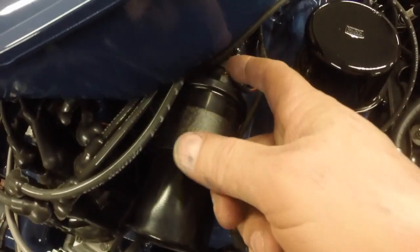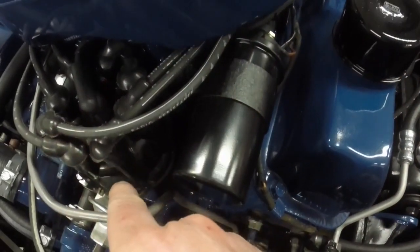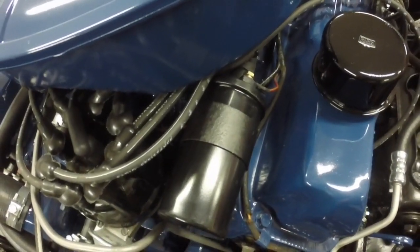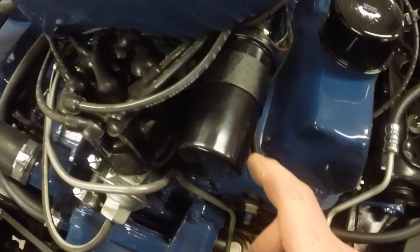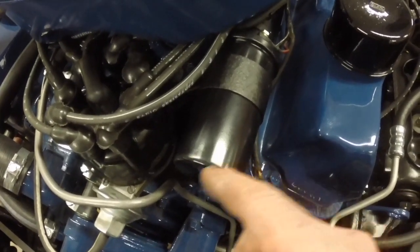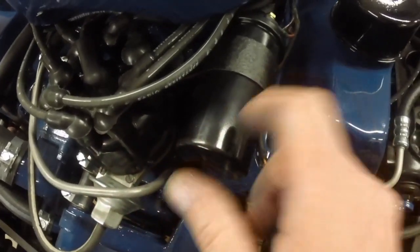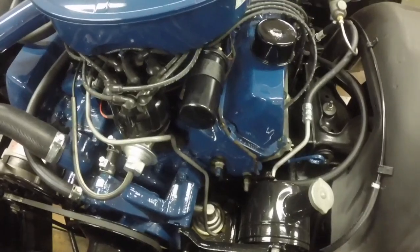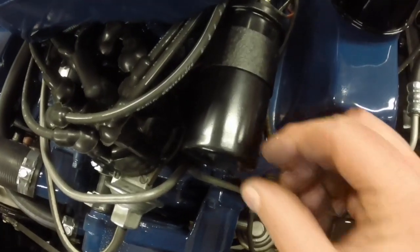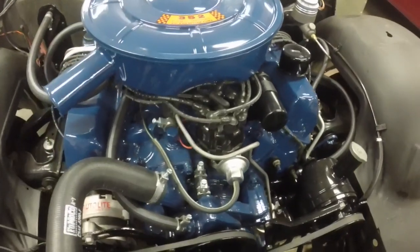So there is battery voltage to here, so I didn't need to run a separate wire to the unit in the distributor. That needs 12 volts in there. You can still run a resistor on your coil if needed, but I didn't. Now I did not use the original coil because I want like things compatible, so I use their stuff in the distributor and their coil. It's such a minor difference. The coil's just a little longer, but it still looks good, and it runs good now.